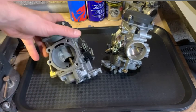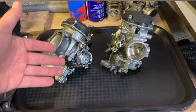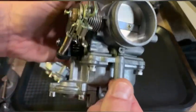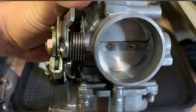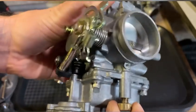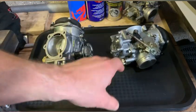I know for a fact that a carburetor I've tuned before with similar threads on the mixture screw — one and a quarter to level — worked out to around three and a quarter turns running great. This one: counting turns to level — half, one, one and a half, two, and a quarter — so two and a quarter. That's one full turn more than the other one.